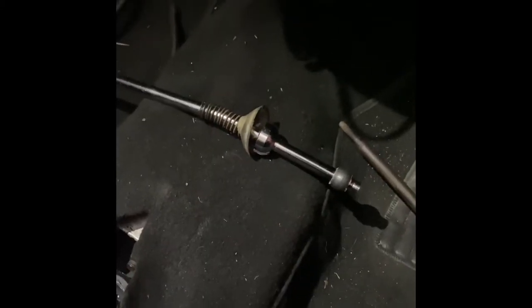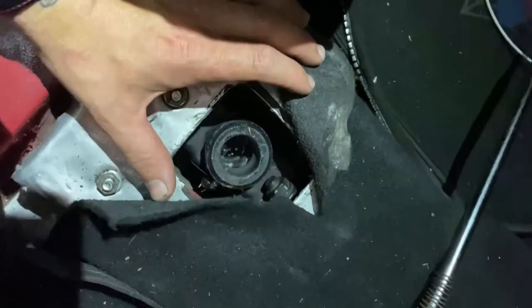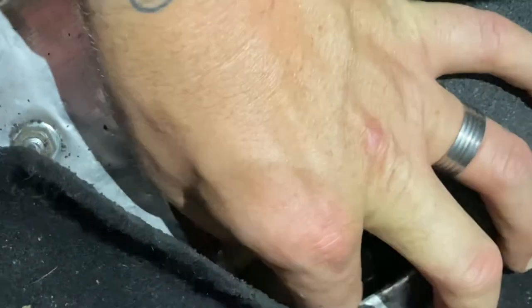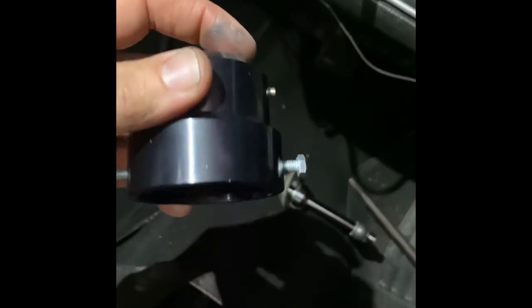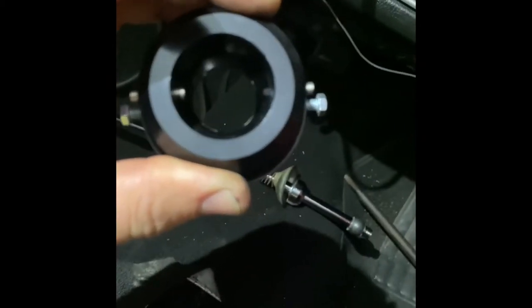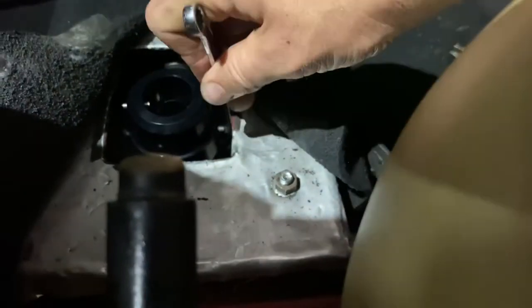The spring and washer we're going to reuse, so we transfer those straight over. Once installed, we get our spacer bracket and fit it to the selector mechanism. Because we have a greater throw, the spacer bracket pushes it up a little further — that's what gives us our leverage. There are two locating tabs; we slide those out, as we're going to use bolts instead. The two bolts screw into the housing of the gear selector and the two pins locate the new gear stick. Tighten the bolts on either side evenly to create an even mating surface.